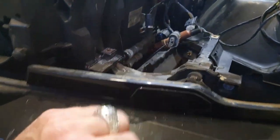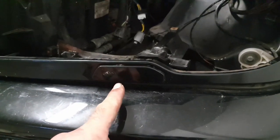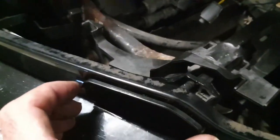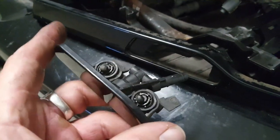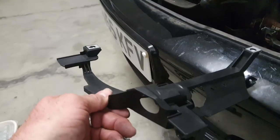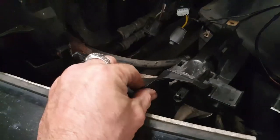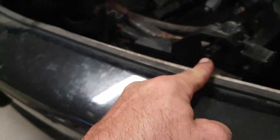Be very careful — it is fragile. After removing it from the corner it remains attached. If you've got the headlight wash, to remove the front trim piece, pull the washer arm out and wiggle it — it does just pull out. I've already removed mine. Removing that makes life a lot easier so you can take the trim off without damaging it. You also get a new trim piece with your new headlights, so if it won't fit properly it's probably because you still have the original one in the car.